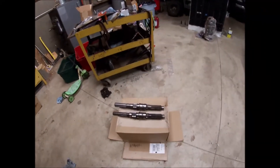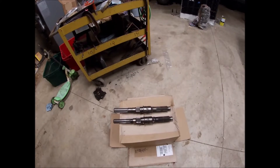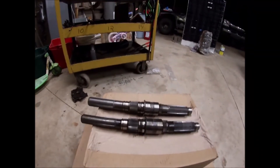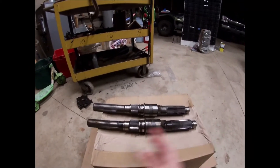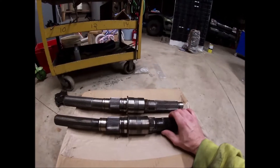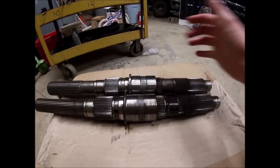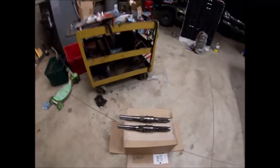For whatever reason, Rock Auto lists this shaft under the 6-liter when you make your selection for your vehicle. I'm not saying it's all their fault - some of it's mine. I should have verified my part fitment. I can't remember if they actually tell you the spline counts on Rock Auto, but they definitely should. Some GM replacement part numbers don't tell you the spline counts either - it can be a bit of a gamble. Here's a good side by side of the wear on this shaft. There's almost no ridge here anymore on the old shaft; there's a real good ridge on the new one. This thing has seen a lot of wear when that pump goes out.